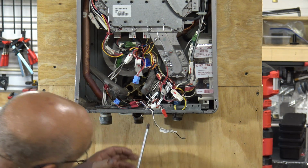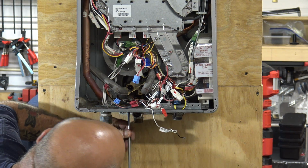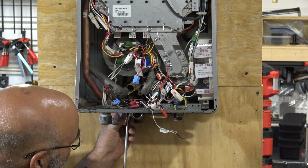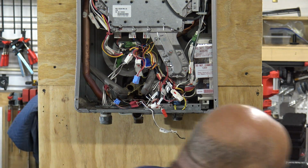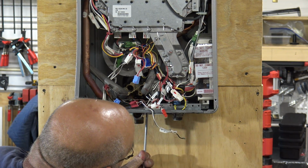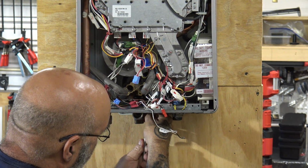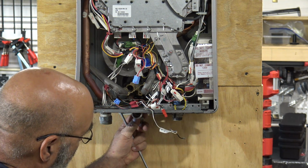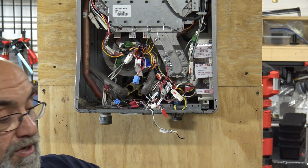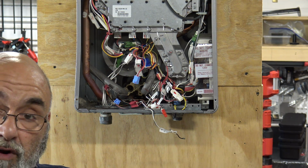All right, you want to remove the water inlet valve. So that's those two number 8 screws. Now, this, of course, is easy to remove because we removed them last week. And those are the two longer screws because they have to go through the actual casting of the water inlet valve. All right, so now you have your water inlet valve off. The union half is still on it. Of course, you have your O-ring. You could remove your O-ring and replace it.